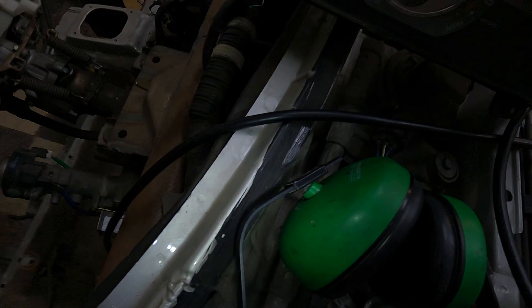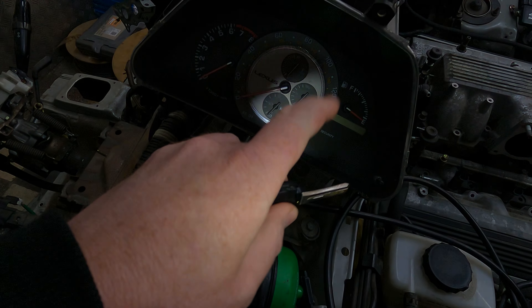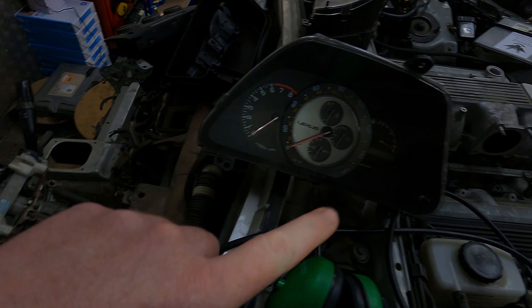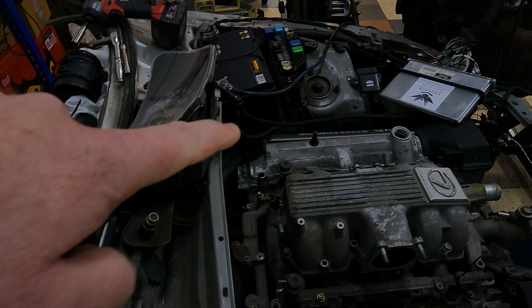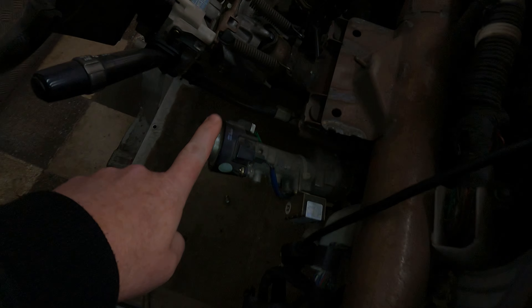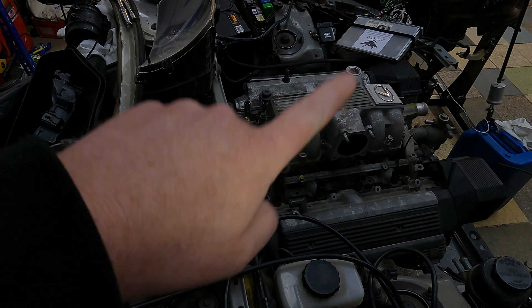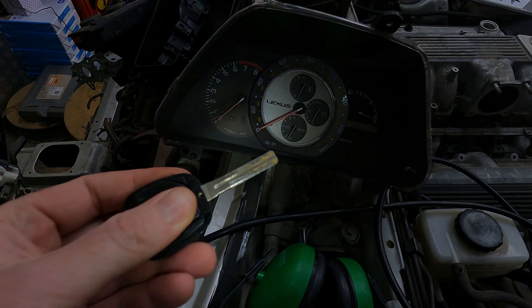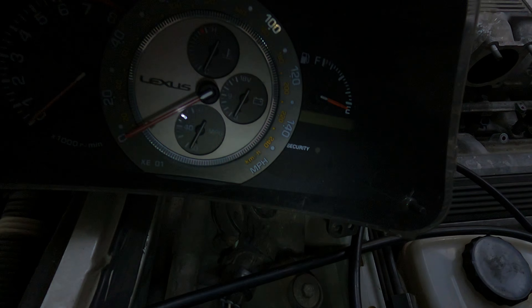Now I'm going to take your buttons from your keys. The way the immobilizer system works is: when I put this into the key barrel, there's a wire that goes to the ECU that tells it to turn on the plus B circuit — that's why you hear the relay clicking the second I insert the key. That activates the plus B circuit, which powers up the antenna in order to read the key, for the ECU to recognize the key and make the security light go away. So you'll notice I'm not even going to turn the ignition on — as soon as I insert the key, that security light goes off. One, two, three...